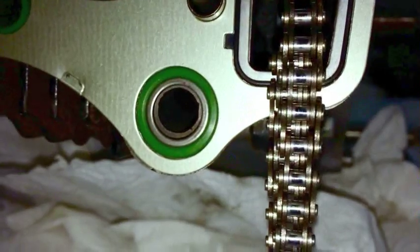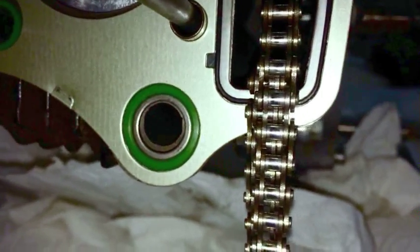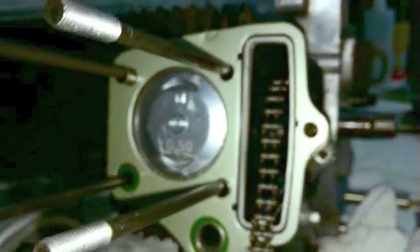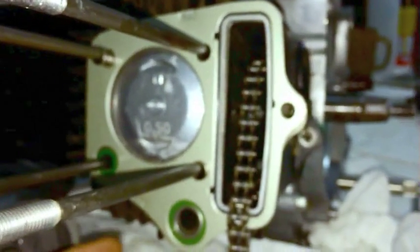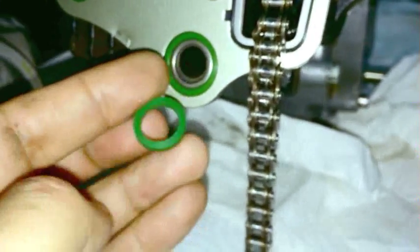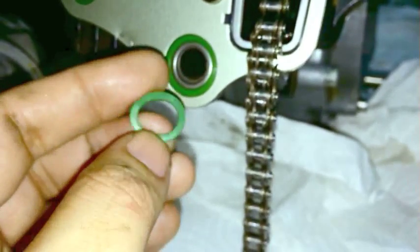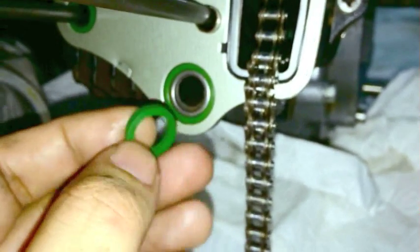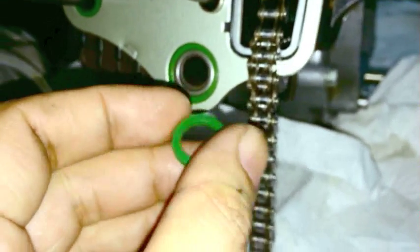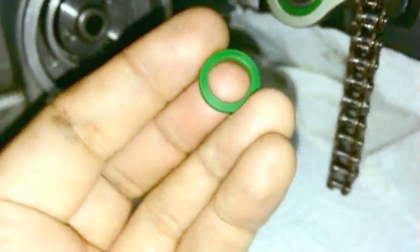I've had two or three times, problems after the O-ring collapsed. But some bikes, I don't know which ones of which years, have just a single fat O-ring, and it's pretty robust. They just have the fat O-ring, the singular one, instead of this. And so my 84 was this way. And by the way, buy new O-rings if you're rebuilding a top end, I recommend, because these do flatten out and they do leak.